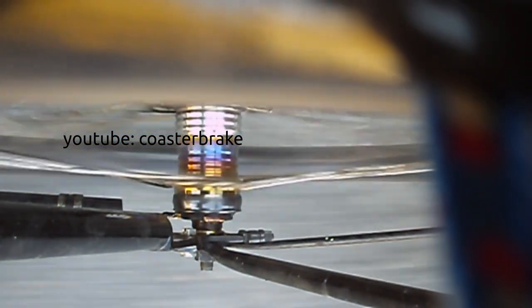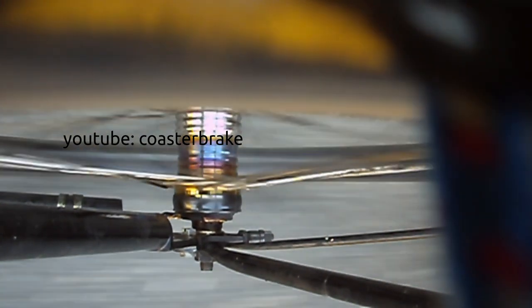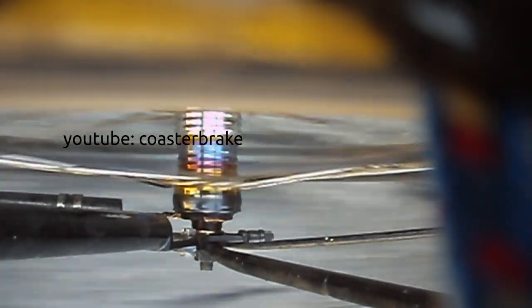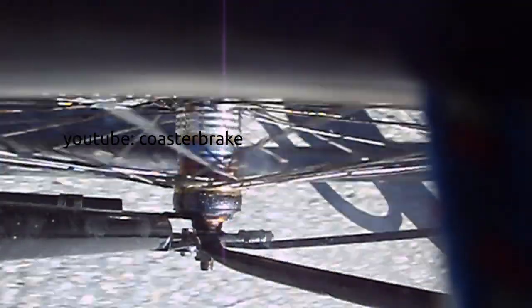The torpedo coaster brake was introduced by Ernst Sachs in 1903, and in 1910 the model 9 or 10 was introduced. All the parts in this hub, a younger version of the hub shells from 1969 or 1970, and all parts from an old torpedo coaster brake around 1910 or 20, you can take out and put into this hub shell. And also otherwise, the parts out of this hub you can put in a hub shell from 1920, and all parts were manufactured for 80 years to be compatible in every torpedo coaster brake.